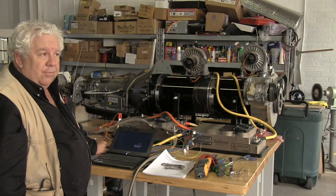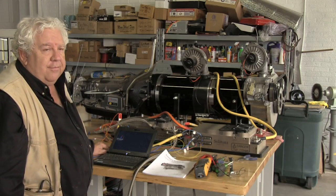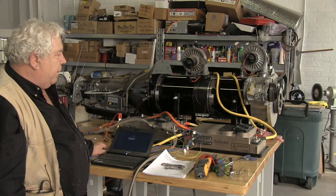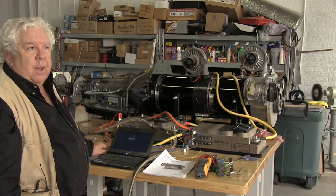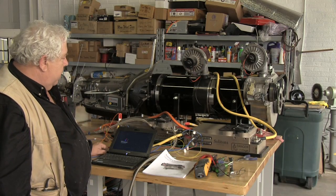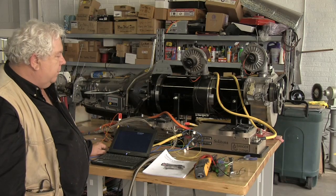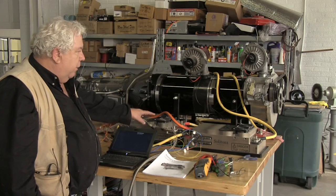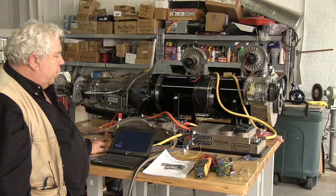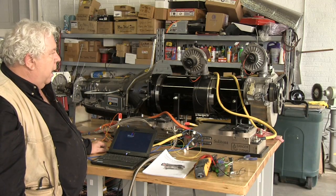This one should drive it at the same rate that it's accustomed to being driven, and that's a 0 to 60 of 7.5 seconds. Now with this weight of batteries, that's hardly possible. But with the same electric horsepower as internal combustion horsepower and that additional weight, I'd say it'll be pretty close. I bet we can do a 9.5 second 0 to 60 with this system and not burn anything up too badly. I really don't want to run 2,000 amps very much through this system. I want to be able to for a few seconds. And I think that in running the two motors and the two controllers, I have a little redundancy there, and I have a little less strain on either controller and either motor. I'm kind of derating this drivetrain by doubling up on what I'm putting through it.